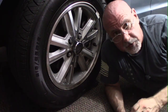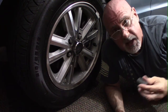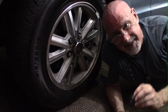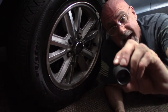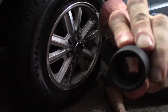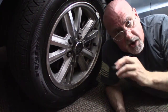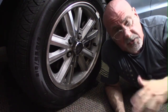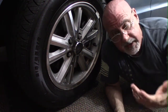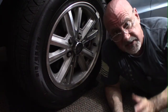I went to the local automotive store and they didn't have exactly what I was looking for, but they said they have a stripped lug nut remover. I looked at it and said this is not going to work. It has threads inside — it's a reverse thread, so you thread it on opposite: instead of righty-tighty lefty-loosey, you do the opposite. But this basically just continued to strip the lug nut.